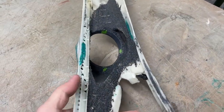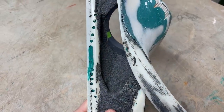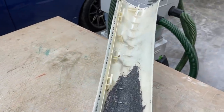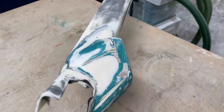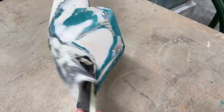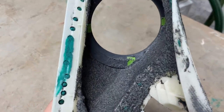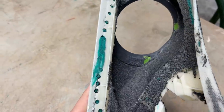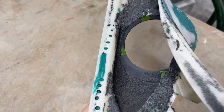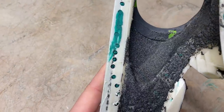So the usual milkshake with a lot of steel mixed into it, and that gives more rigidity, more weight to make it more dead. But all that will need deadening all the way up on the plastic. And now it's officially ready for the trim. Just put a bit of tape over the threaded inserts because we don't want anything going into it, screwing up our thread, because after that you can't clean it out, especially if this stuff goes into it.